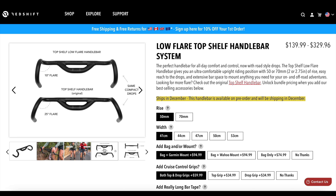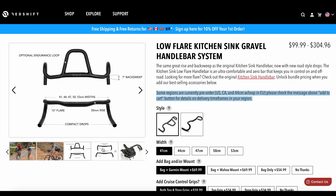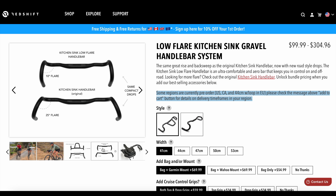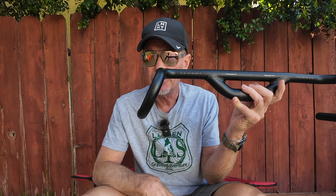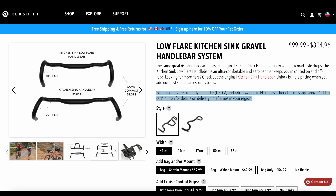Well, Redshift has kind of changed that a little bit. Now they're offering the top shelf handlebar and the kitchen sink handlebar down to a 41 centimeter wide width. Check the diagrams on their website because the flare can kind of change that measurement. Speaking of flare, along with being narrower, the new low-flare versions of the kitchen sink and the top shelf have 10 degrees of flare, which is going to be just a little outside of vertical — not near as extreme. And actually for the road, that is just about perfect.